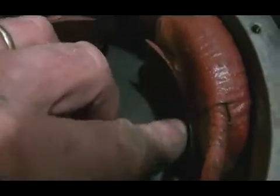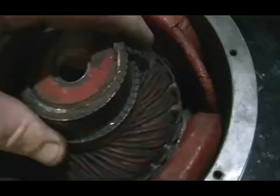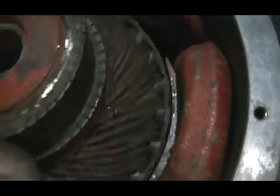It's only one bolt that holds them in and a die lock. So I had about 2mm clearance on it from factory and I wanted to get that down to as close as possible. We've got it within about half a millimetre now. If you sit the rotor in there you can see the gap is very, very fine — we won't be able to get it much closer than that.